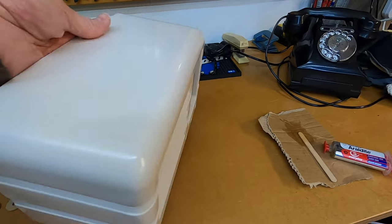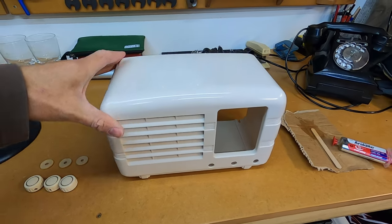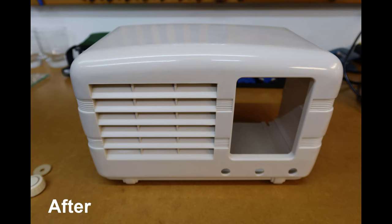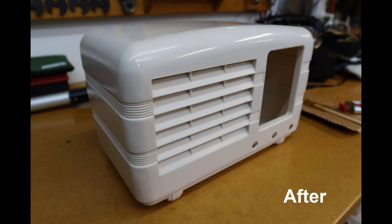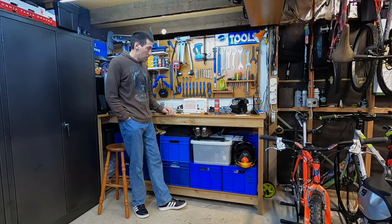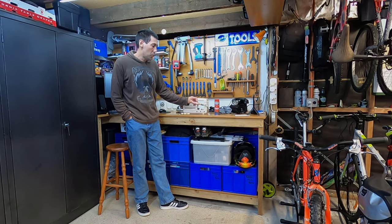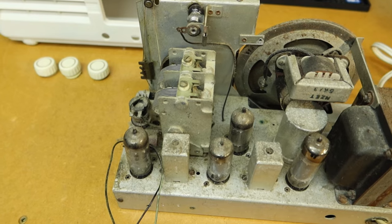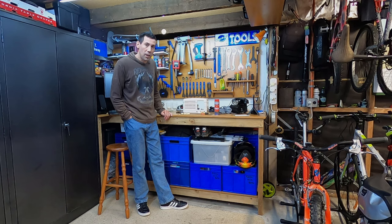This part of the project is done and I'm really happy — this has turned out really well. This old Colt radio case will definitely see another day. That brings us to the end of this video. We've successfully polished the casing for a Bell Colt radio — just to recap, the two polishes used are AutoSol metal polish and Brasso to finish it off. In the next radio video I'm thinking of looking at the chassis for the Bell Colt radio, seeing if we can clean that up and work out a plan on getting it going. Thanks for watching and I'll see you on the next video.